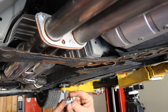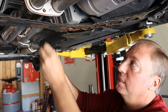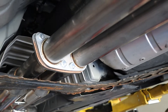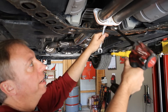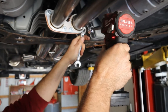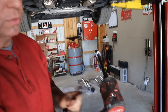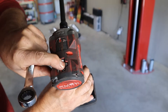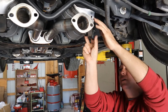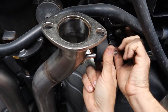Before we put these bolts in, make sure you put the washer on the bolt head side — they furnished that with it because the nut already has a locking washer built on it. The nuts on the back side are 14mm, and the front side are actually 16mm. I have the impact turned down — the Milwaukee Fuel allows you to select one, two, or three — we turned it down to two and we'll finish torquing those in a little bit. I have the rubber mounts placed on the new exhaust and we can flip those around so they fit right in place, then put the original nuts on and snug those down.